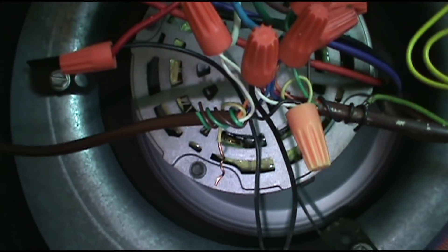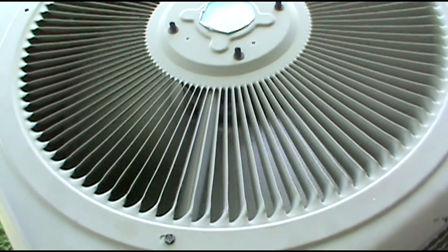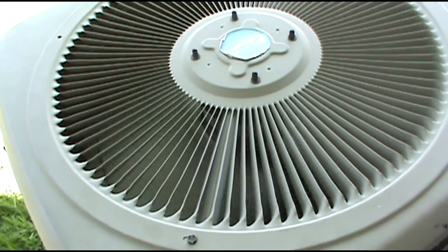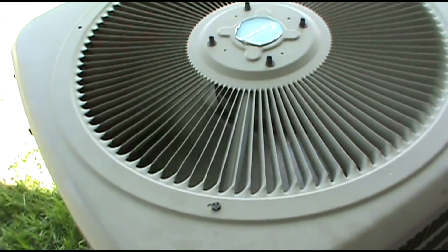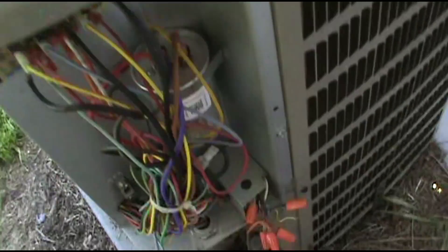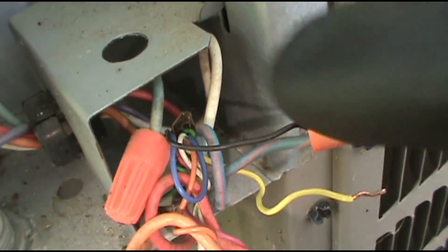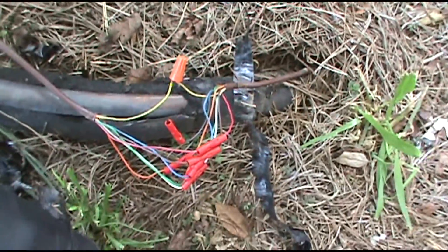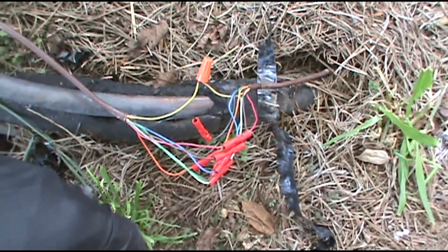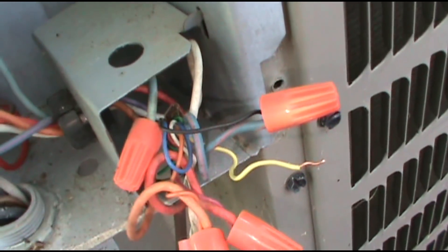We're still running — it's been about five minutes. It was shorting out pretty quick; sometimes it would run for two minutes and then short out, sometimes it would be immediate. I took the yellow wire totally out of the loop and substituted the black wire that wasn't being used — and I think we got it. We're going to try to clean all this mess up here. I think the landscapers tried to get away with one here. Alright, let me go button it back up.